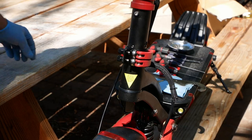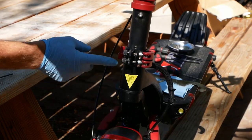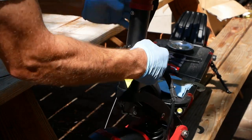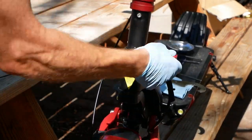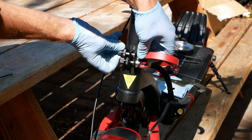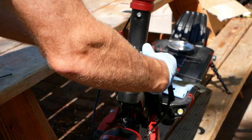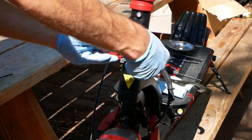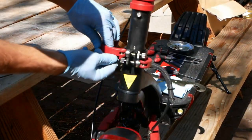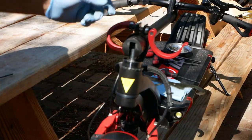I'm going to tell you two things I do to the clamp area. First, I find that the backside nuts and the clamps kind of get in the way of each other. So what I do is I just take one of them — doesn't matter which — and I flip it. It probably seems like a very simple thing, but I find it really does help. You don't get quite as much resistance from the pieces, and you can get a better side clamping force.